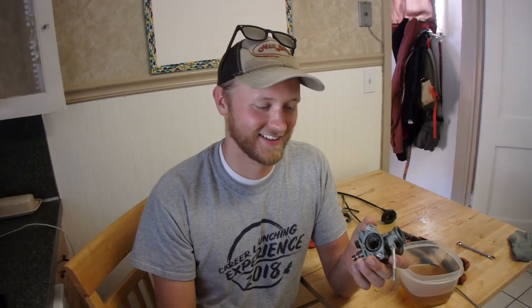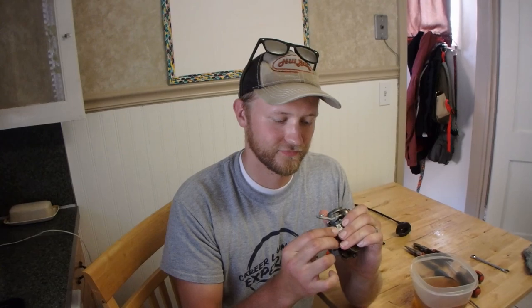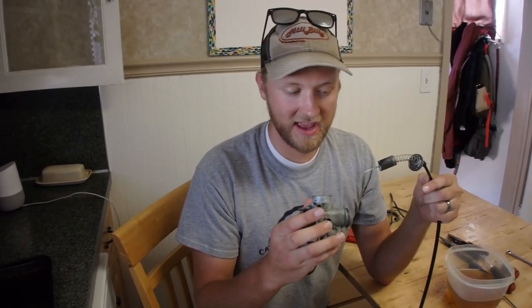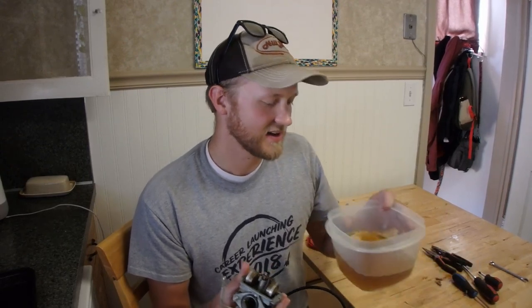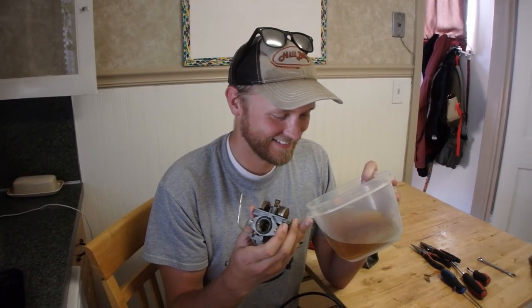Jenny tells me I have a sweaty face. I didn't say that — I said a nice hard-working sheen of sweat. Thank you. So the boiling trick worked like a charm — I would definitely do it again and would recommend it. It didn't really damage anything. It took two minutes of boiling and the throttle slide popped right out of the carburetor where before it was totally stuck. Then we put the parts in the evaporust — these are the leftovers from the evaporust I used with the rusted cylinder. Very thrifty! Don't sniff it.